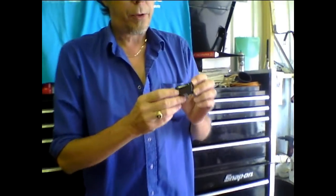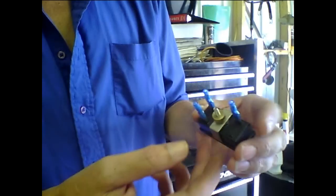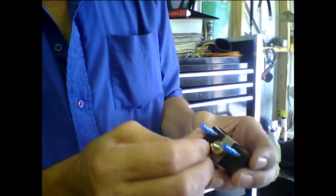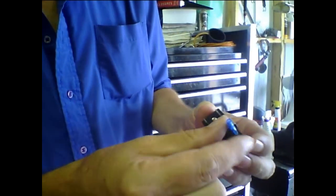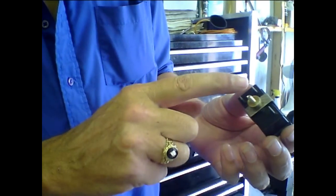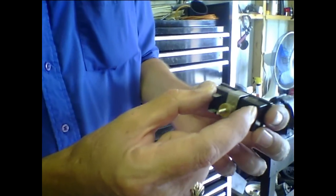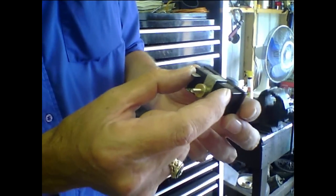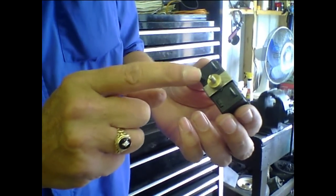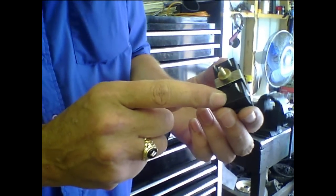We start with our most popular LED meter. Once you get it and take it out of the box, you're going to turn it over and you'll see you've got three little pegs. We're going to remove these — this is what we're going to hook our wires to. We're going to run our wires from the first two pegs back to our power source coming off the battery so we can get a direct reading. The last one goes to the key switch, which powers up the LED meter itself.